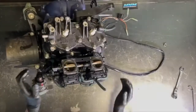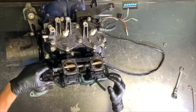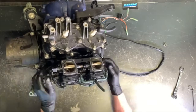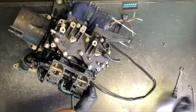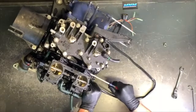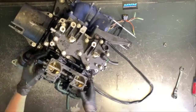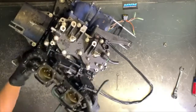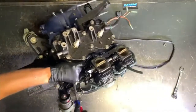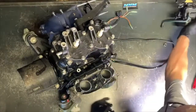Loosen these up. After we get all four of those off — we've already pulled the cables off. Throttle cables come in through here, and when you push that throttle it's going to turn these butterflies. I'll dig into that further when we rebuild the carburetor. We've got one hose still connected with a zip tie — I'm going to pry that up. These hoses will be replaced. There's another line going to this other side. Both those are off — there are our carburetors. I'll set those aside for a separate video.